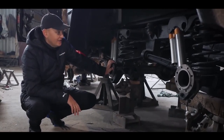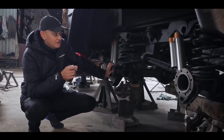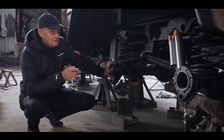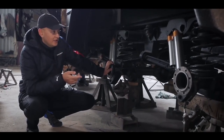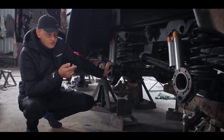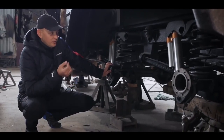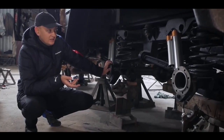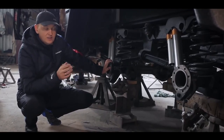We spent a lot of time with the brakes. All metal pipes are new from beginning to end. The brake housings are new too. A breather pipe was made. You know what a breather pipe means, don't you? Every axle must have a breather pipe. All of them need lots of time because they are new. So we came to the point when the side reduction gears can be gone through. Let's go work.